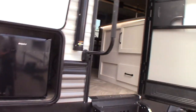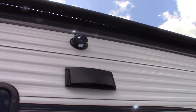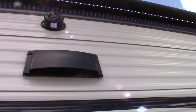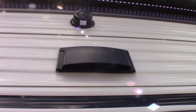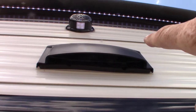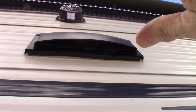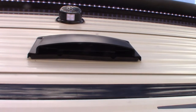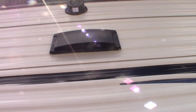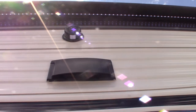You have a power awning with LED strip. This right here is a vent — it's a vent for your range hood. One thing you have to remember is that if you're going to vent to the outside you have to reach up and put your thumb underneath the baffle there and free it up so it flaps freely, because you won't vent to the outside unless that baffle is flapping freely. Always do that when you're trying to vent to the outside.